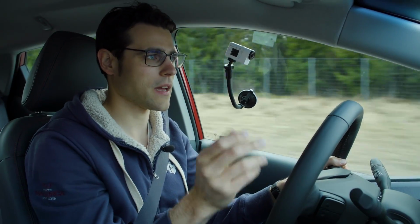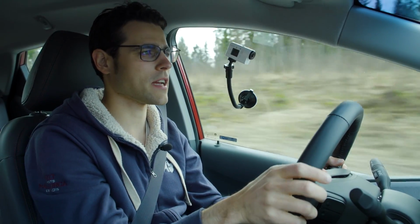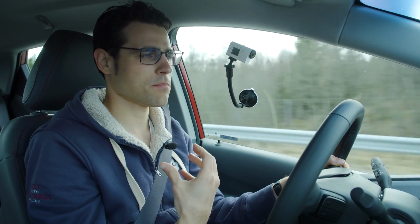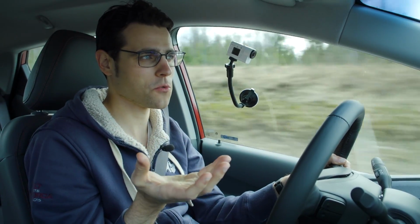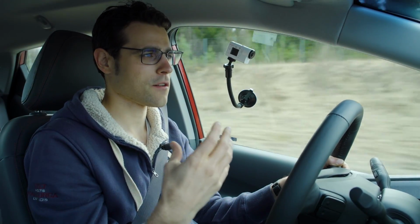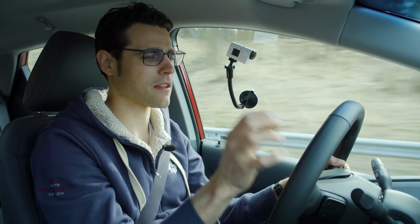It's also possible here, if you are at the moment in the L mode, then you can basically control the whole car just with your right foot and don't use the brake at all, unless it's an emergency situation where you need more braking power. Or you go for the D mode, have less resistance. That's what I would be preferring, because I don't really like the one pedal feeling. I like the idea that you can do that, but somehow when I leave the throttle, I get a feeling of freedom. I want to just roll, sailing a car, rolling a car, that feels good. And I think that should be included also in this car here. Here it's more like in the Kia Soul EV that you have a little bit of recuperation there.